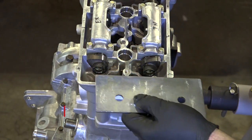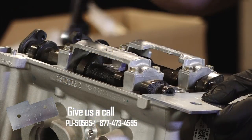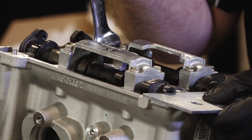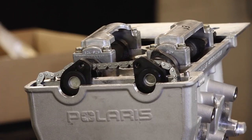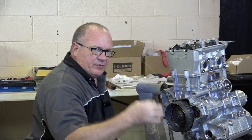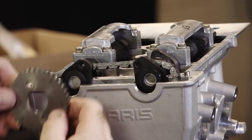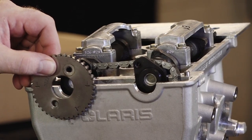Next let's get this plate installed on the exhaust side — it'll just slide in. On the intake you're going to have to use a wrench, bring it up just slightly, and that's going to be where they need to stay while we set the timing. We want to start with the intake gear first. The difference is one has an E and one has an I stamped on it, so it didn't matter if you didn't keep up with which one was which. We want the intakes to be sitting in there like that when the chain's on.